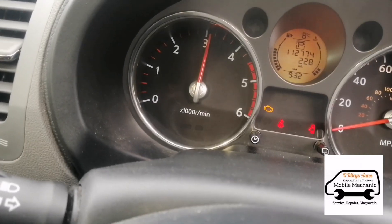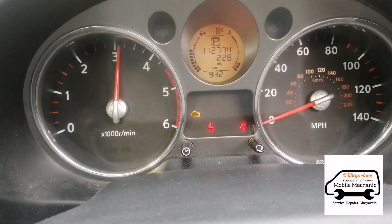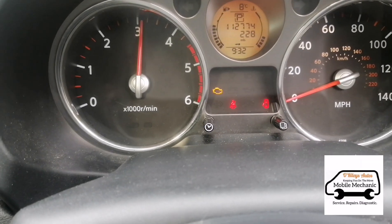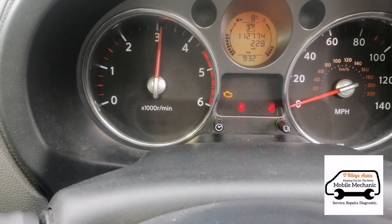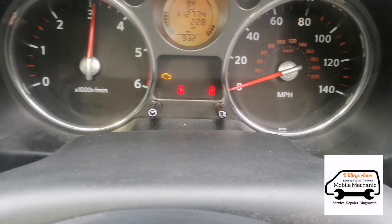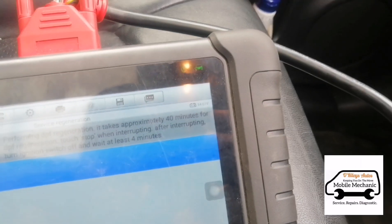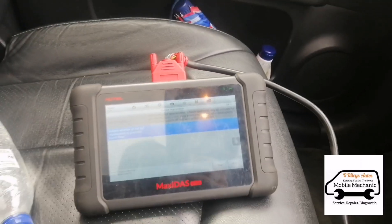Before we started the vehicle we left the fluid sit for 10 minutes inside the exhaust system. Hopefully once this is done we can get rid of this engine warning light — the customer is also experiencing an extreme loss of power, so we should be able to get this sorted. You don't have to do a regen but we might as well while we're here; it's just going to help a little bit extra, push all that stuff out and clean it.